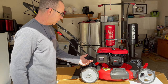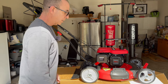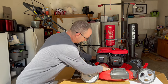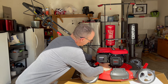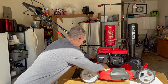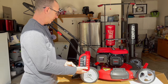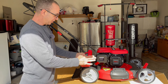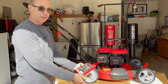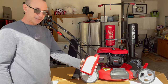Here are the levers to raise it up and down. Fuel goes here. What are your questions? Put them in the comment section and I will certainly answer them. If you look right here, they did give you the oil — but you can't see it because it's red on red and they got it shoved in there. There's actually 10W30 motor oil sitting right here and it's 16.9 ounces. From my previous video, that's exactly the amount you need — you put the whole thing in there and that's exactly what you need.